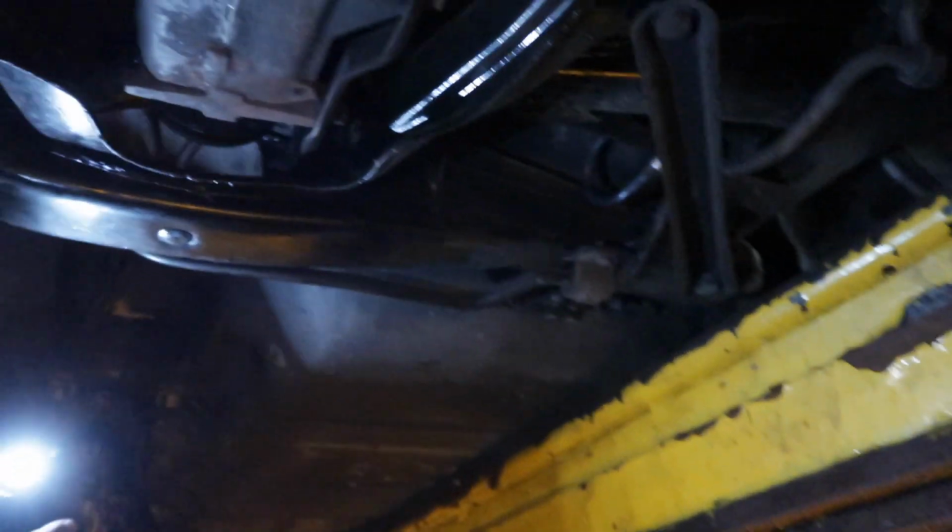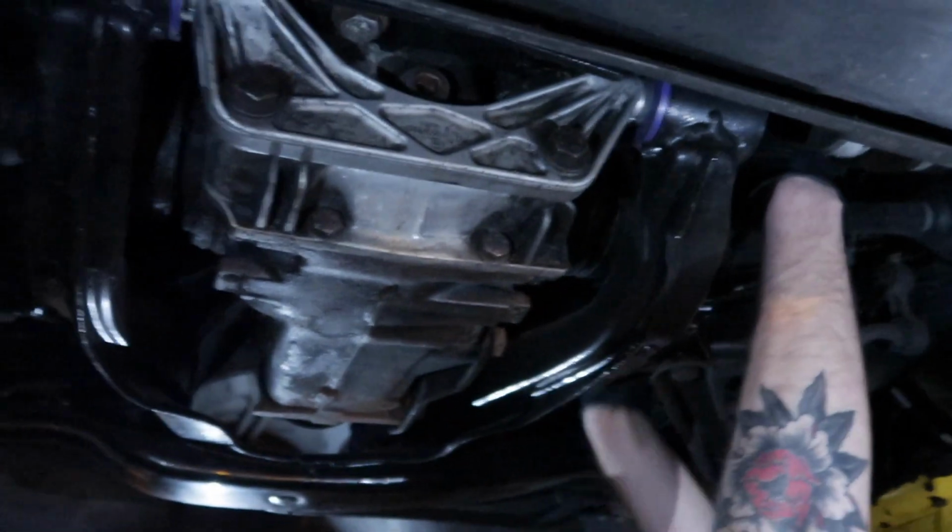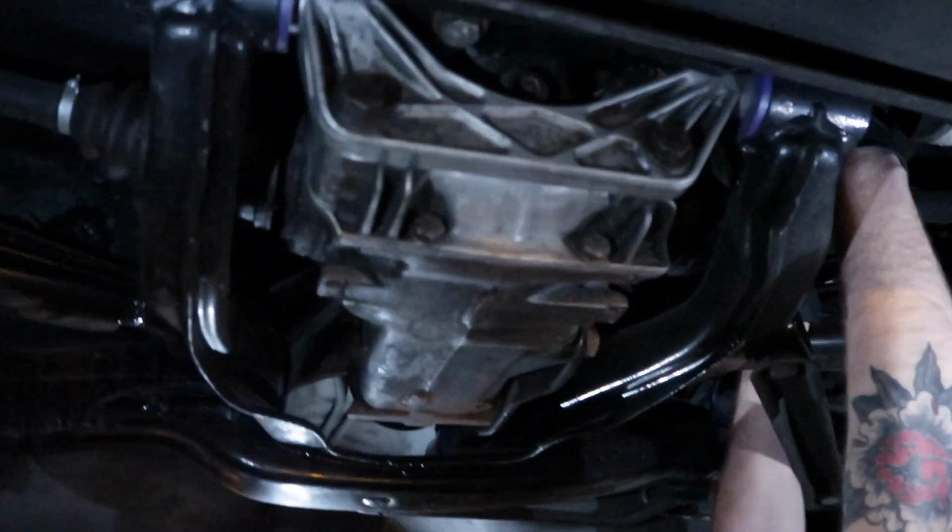That's tight. Wait, you don't have an LSD in this car? I do. It's a 323. Where's the S? It came off. Oh, I swear it's 323. Sure, yeah. He's lying. We're trading. He's lying. No, we're still trading. Oh yeah, I forgot I was supposed to get this diff. Yeah, you are. I'm gonna give him my 346 because that's closer to the E46 M3 ratio, and I'm supposed to take this 323 because it's lower for boost.